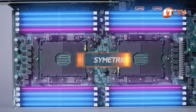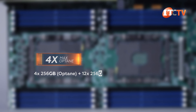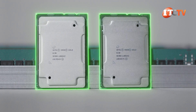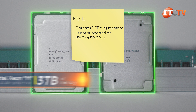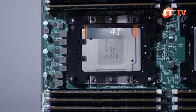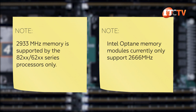Here are a few of those configurations. A maximum of two Optane memory modules per CPU are supported, for up to four terabytes of memory with support from a second-generation M-Suffix processor, which will support up to two terabytes. However, keep in mind the system can be outfitted with the previous generation Intel Xeon scalable processors, which will only support a top capacity of three terabytes with M-Suffix processors, or 1.5 terabytes using standard scalable processors. The 3DS LR-DIMM memory speed will also top out at 2666 megatransfers per second using first-generation processors. So if you want the full four terabytes and a top memory speed of 2933 megatransfers per second, or if you want to use those Intel Optane data-centric persistent memory modules, which can provide lower latencies and hyper-speed storage capabilities, then go with the second-generation processors.